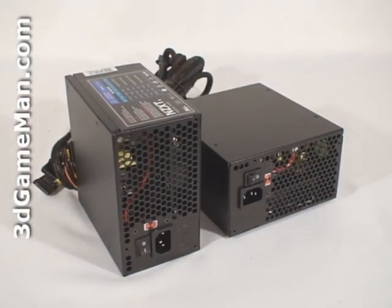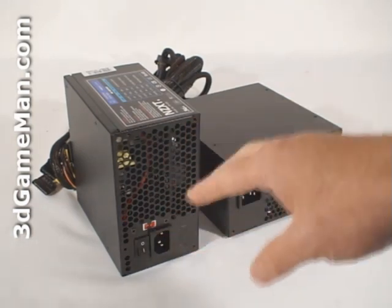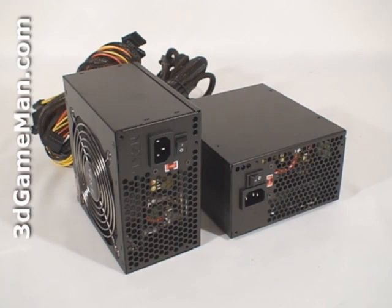Third, it should meet the latest ATX and other current standards, environmental directives, over voltage, under voltage, and other protections — these power supplies meet all current standards. Fourth, I'd recommend choosing a power supply that has a PFC. A PFC, or active power factor correction, assists the power supply in being more efficient and therefore stable under load. A PFC basically reduces total harmonics, corrects input voltage, and allows for full input voltage range. Thankfully, these power supplies have a PFC.